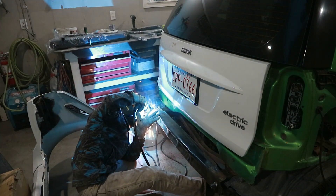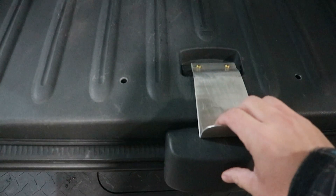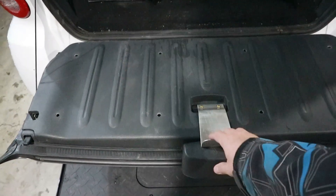I welded those in and put the car back together, so now we've just got two half-inch female threads on the bottom of the car — that's where we mount the bottom foot panel. The M6s on the body mount the handrails, and the bottom seat mounts directly to the tailgate. There's a flip-up plastic hatch there for access to the underside where we drill holes and run bolts through. We also had to build a little aluminum pull tab so you can still activate the latching mechanism when the seat is bolted on — you still want to be able to open that tailgate since that's where you store the charger on this electric version.